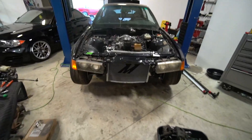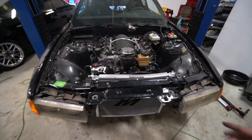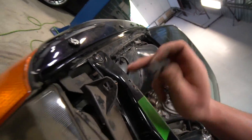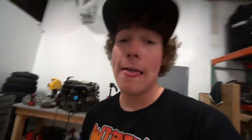I started to attempt to put the front end on and realized I have no bolts — kind of forgot how it went on. I have the lights placed here but it's not working out without any bolts. I'm going to start it, quickly lift it up, check for leaks, then shut it off — because we don't have a belt yet. I just ordered an LS1 pump because the LS2 pump won't work, and I also ordered the bracket kit for the LS1 pump to mount it. I still need to order hardware for the front end, which is really annoying.